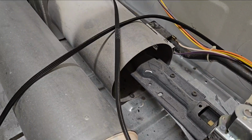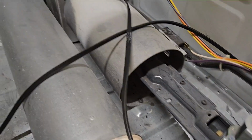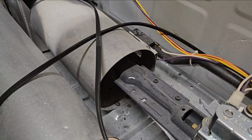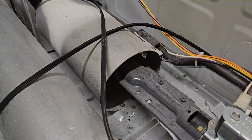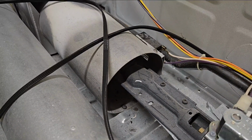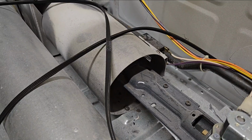So I tested out everything till I got to the igniter. I haven't tested out the valve, obviously. The valve is closed, and if the igniter never heats up, the valve shouldn't be opening. That's what the flame sensor should be doing good on.